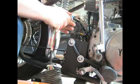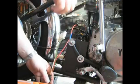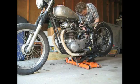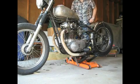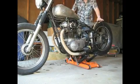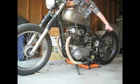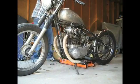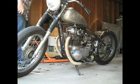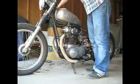The only thing left is to wrap it up and clean it up — maybe some electrical tape, wire cover sleeves, zip ties, whatever you'd like. Nothing left to do except take it for a ride. Clean it up, go for a 20-minute ride, come back, and check your battery. You should be reading about 14.5 volts. If you're not, first check your connections, second check your rotor — the XS650 rotor is notoriously bad. Then start going through and double-checking all your other parts to make sure nothing is faulty. Thanks for watching and have fun.